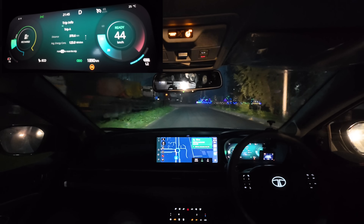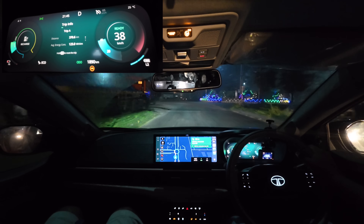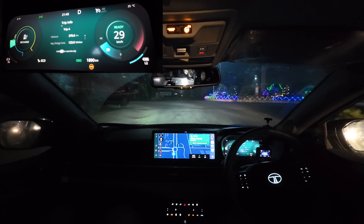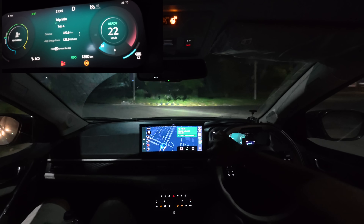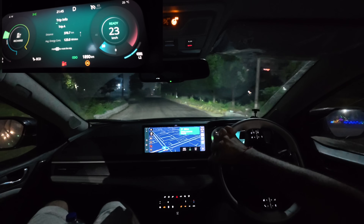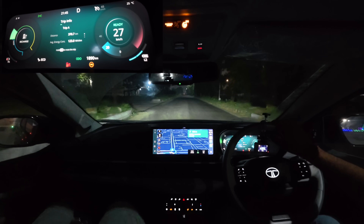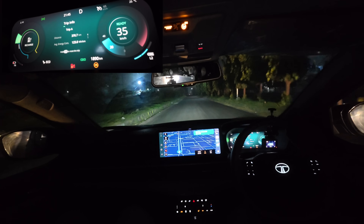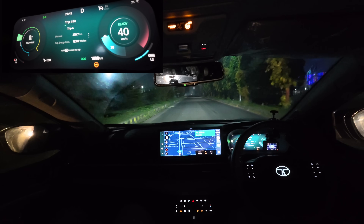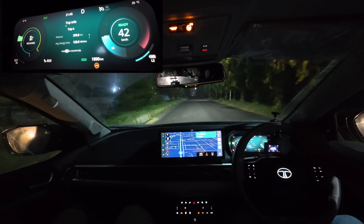The car is running at 351 km covered with 5% battery left and continuously beeping to go charge. Energy consumption is 125 Wh per km. The car is telling me it will go up to 300-370 km total. Let's see how much more it can go to reach the charger. Friends, the car has reached 370 km — the maximum limit of the C75 has been achieved, knowingly.